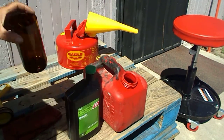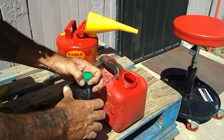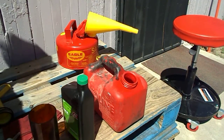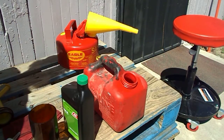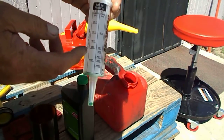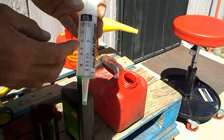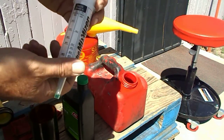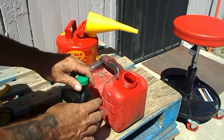I have a different system — my system involves pouring the oil into a jar. You can use synthetic oil for this, but it's recommended that if you do use a synthetic oil, use a good one and mix it exactly to whatever ratio you're trying to get. On the Mix Miser here it goes as low as 25 to 1, but for a pint of gas — or I think it's per liter. Anyway, what we're doing today is 32 to 1.